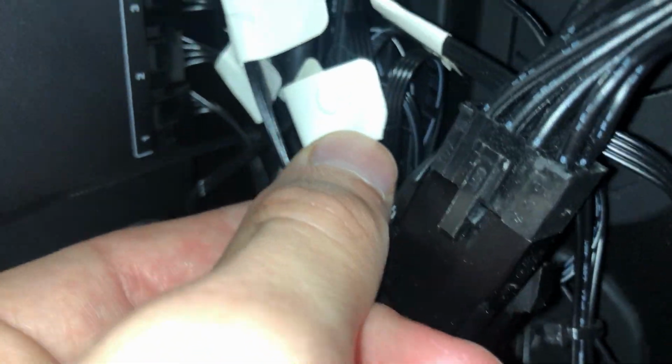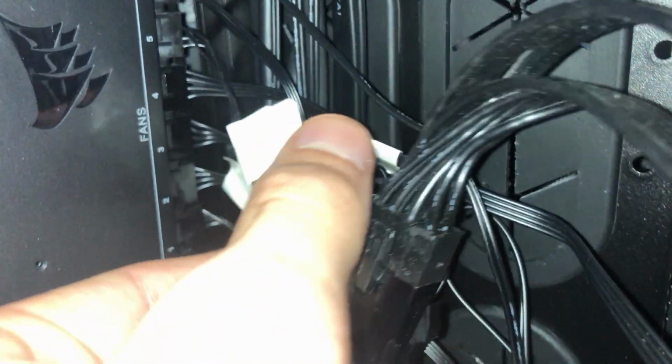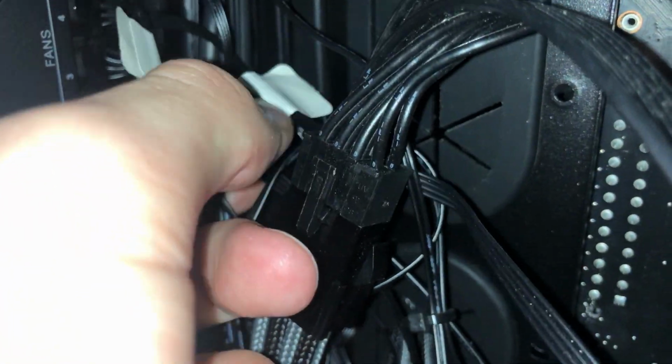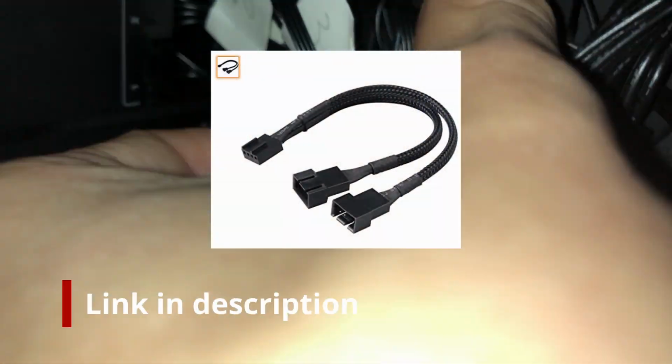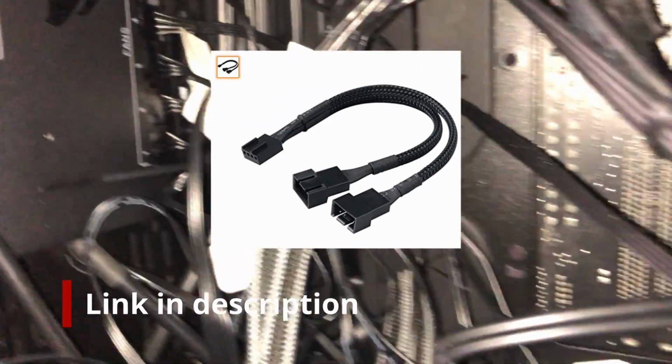However, the problem you may run into is you might not be able to control them all. I've seen some messages on forums saying that the fan headers will only be able to control 1 fan per header, even though you've got 2 plugged in. But I'm not sure, I haven't tried it, so it might be worth trying before you buy a second Commander Pro. Definitely be a lot cheaper.